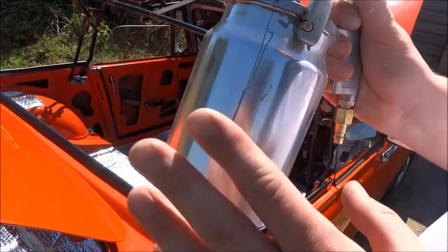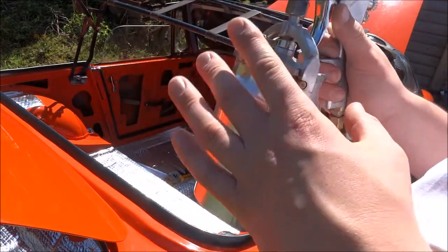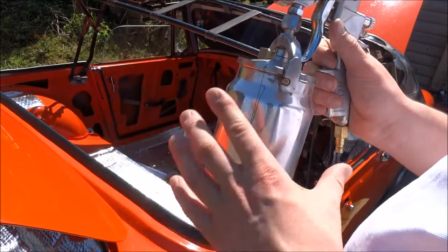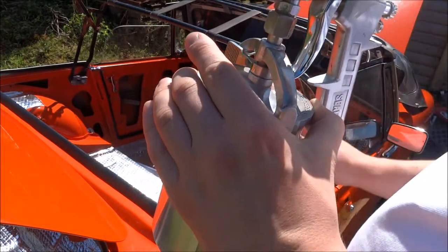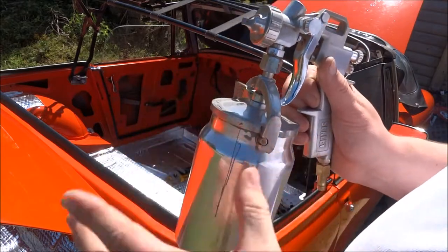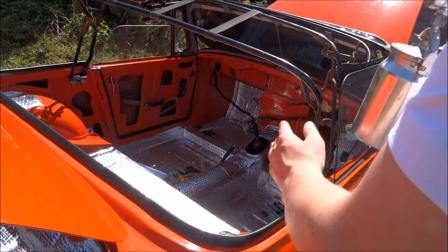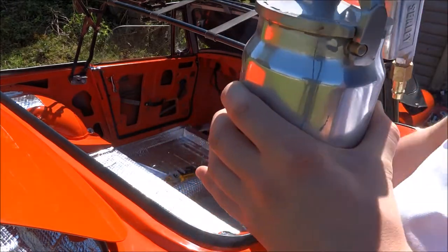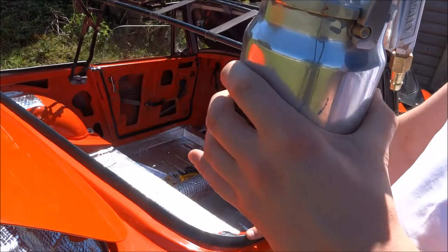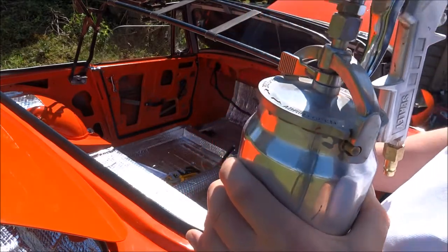When I was applying the zinc for the base of it, I mixed that with 1% standard thinners, and that was just to thin it out and give it a smoother finish. Then I used a thick primer on the top, sanded it down a little bit, went over with the cellulose 2-pack paint in the colour I bought, and that was the finishing touch. And it doesn't need a second coat either.